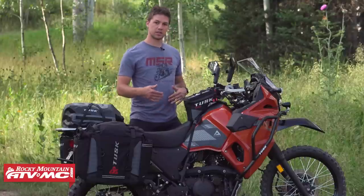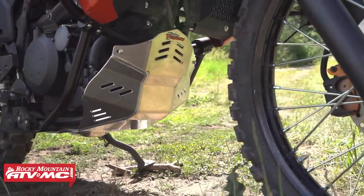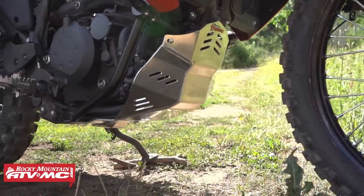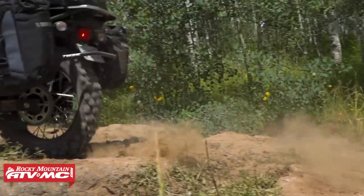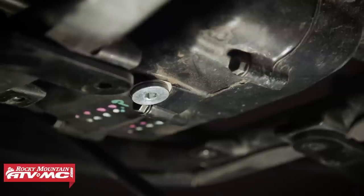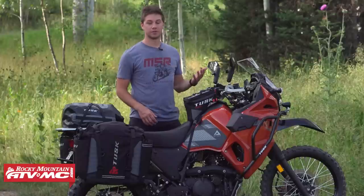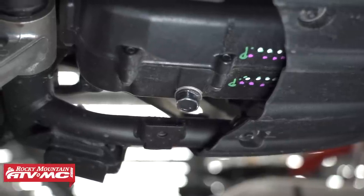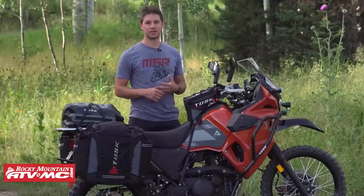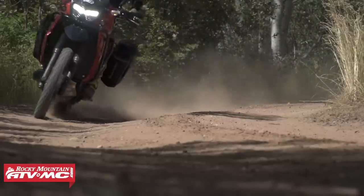Going along with the lowers and getting protection underneath, we've got the Enduro Engineering skid plate — a great accessory. It's a full aluminum skid plate with great protection for the front of your motor, and a really great upgrade from the plastic skid plate that comes stock. What's also nice is a low-profile magnetic drain bolt. The KLR's drain bolt sticks out like a sore thumb underneath, really susceptible to hitting rocks and logs on the trail and breaking your cases. The low-profile drain bolt protects that, tucking the bolt up so it's more protected even with a stock skid plate.